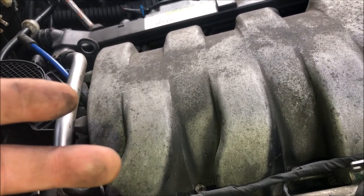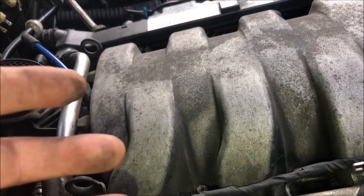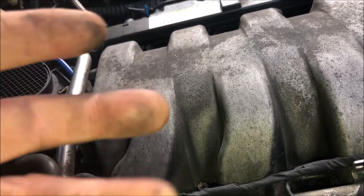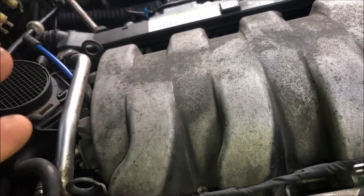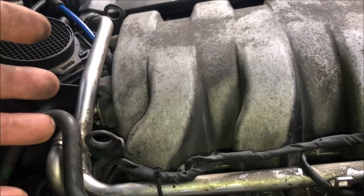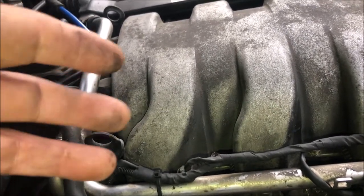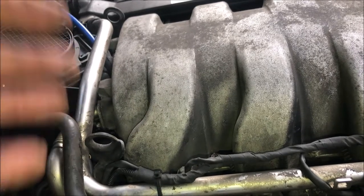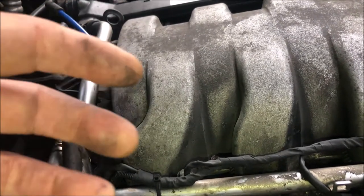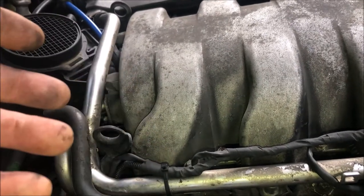I think that's basically, it's cooling the intake charge. It also provides a little bit leaner running, I guess. It's not open all the time. It's not open at wide open throttle. It's only open at certain moments, like deceleration, when you let go of the gas really quick. Like if you accelerate hard and then let off the gas, then your EGR valve will generally open.